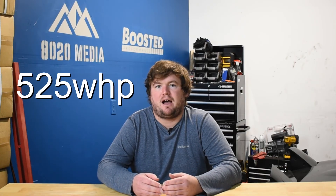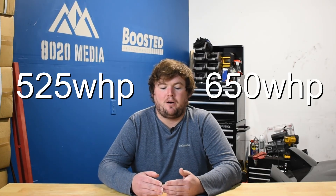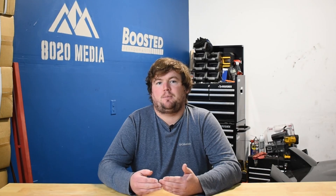That really wraps up all the mods required on the N63 to push anywhere into the 525 to 650 plus wheel horsepower ballpark, depending on what year, model, and variant you have. A tune, an E30 fuel blend, downpipes, and an intake is all you're going to need — really incredible and highly impressive gains with such simple, easy, and cheap bolt-on modifications. That wraps up our video for today, guys. If you appreciated the content, please hit that like button, subscribe to the channel, and check out the description below for more awesome N63 content.